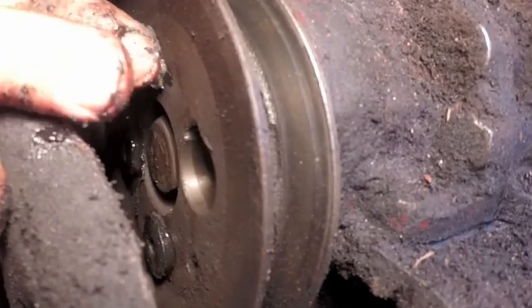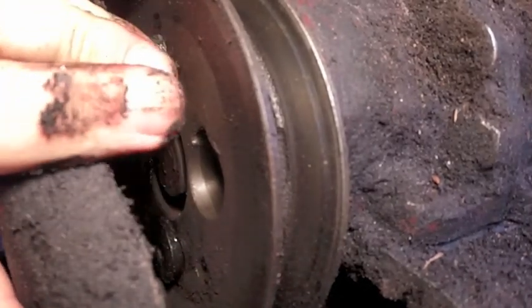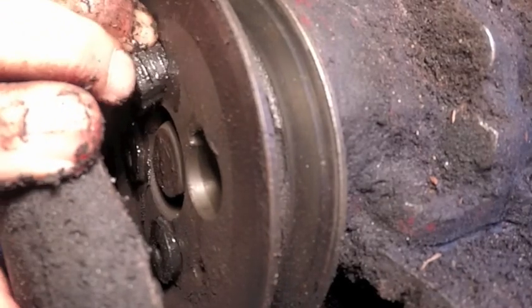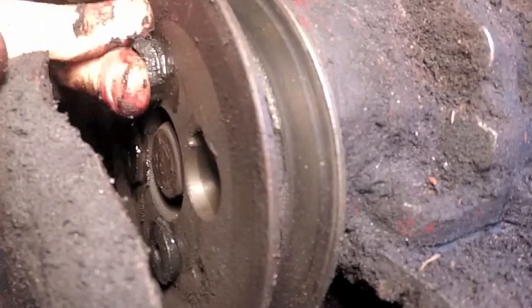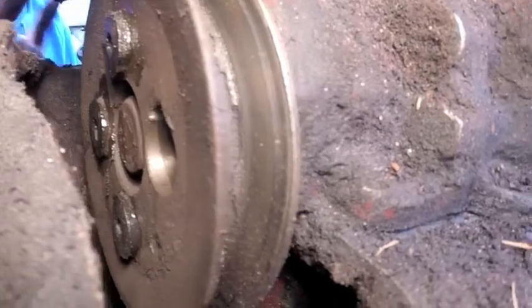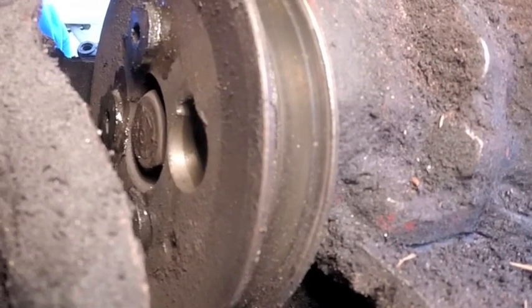Those pins ground their way into that crank pulley a little bit. Look at that — I couldn't see it, it's so tight in there. I got the GoPro camera just shoved up really close and I didn't notice how it had... I kind of augured that hole out a little bit. I don't think that's going to be a problem, but all four of those bushing holes in the pulley are augured out. I'm going to keep an eye on it. For 17 minutes I could have a whole new set of bushings cut — actually it'll be shorter now because he's got it saved in his program. It's just a matter of bringing the rubber down there and cutting new bushings. I suppose I could pull that pulley out and fill it with weld and re-bore those holes, or make metal bushings.